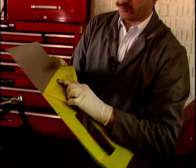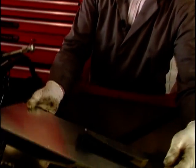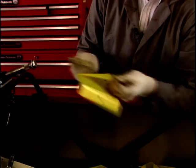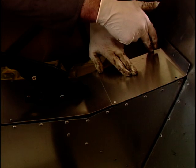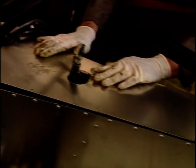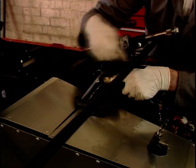I'm just removing the protective layer from this aluminium sheet, and this is the bit that covers up the transmission tunnel — this is the fourth bit. That's one done, and it goes like that. These here are held on by screws so you can get in and adjust the handbrake, and the rest are riveted on using silicon sealer as well, making sure that we get that grommet in there for the wiring loom.